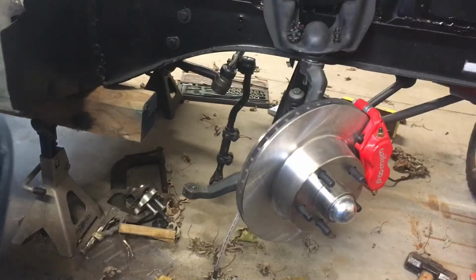So the background is I over-torqued the nut on the new tie rod end, and it stripped the nut, so I had to cut the nut off, and then I cut the tie rod off on the other side. So now I have a little taper stuck inside the hole in my spindle. I got asked on the Vintage Mustang forums for some advice, and those guys gave me a lot of good ideas, and I'm gonna try a few of them today, and hopefully one will work. So wish me luck.